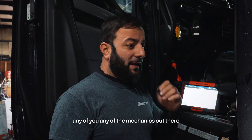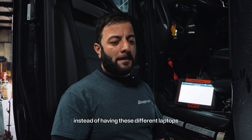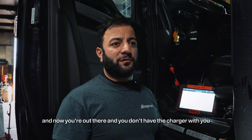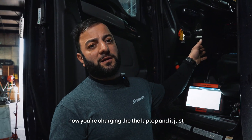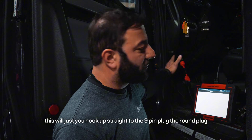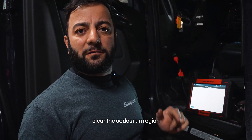Any of the mechanics out there, any of the roadside companies out there just trying to get into the business — I highly recommend this, and I know it's a lot of money, but in the long run it pays off. Instead of having these different laptops where you're trying to scroll through, now you have a charger, you were busy the night before and forgot to charge the laptop, now you're out there without the charger, or somehow you have a power inverter and you're charging the laptop — now you need more cables. In the long run, you want something straightforward. You hook up straight to the nine-pin round plug, go into heavy duty, go into test, clear the codes, run regen. That's what you want.